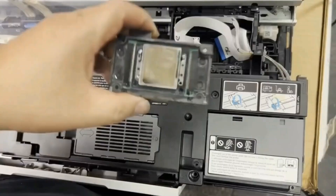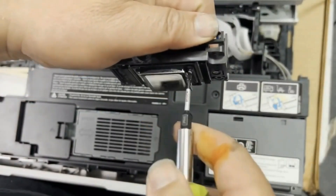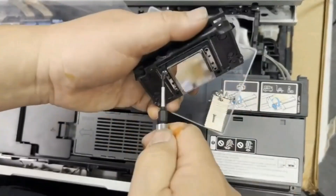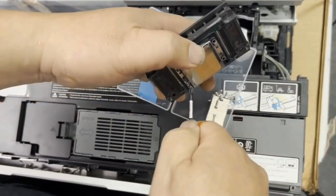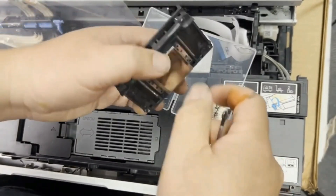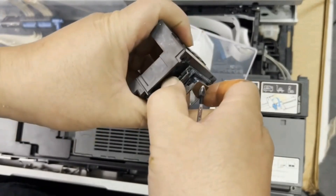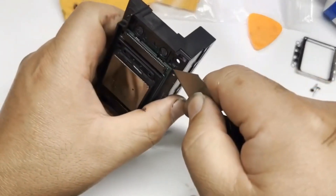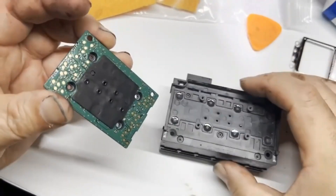You can install them wet. Then we need a size one or size zero Phillips screwdriver. We take off those screws on the bottom. You want to save and guard those screws like your life depends on it, because if you lose them, you'll never get a replacement. Then push your hand and separate the PCB board from the body. You might have ink stuck on it, so just use a razor blade — just poke a little bit. It should separate really easily; you shouldn't require any kind of brute force.